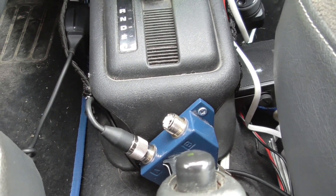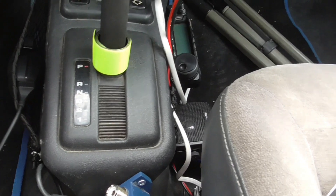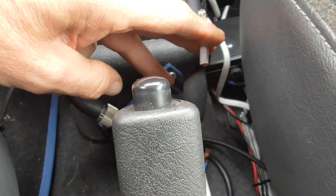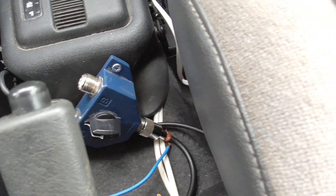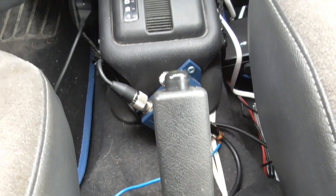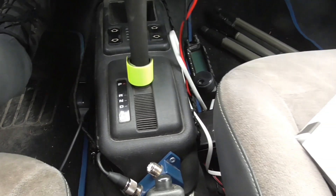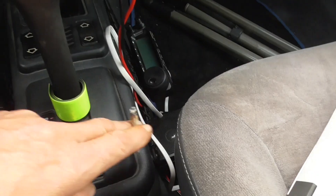Now, the feedback thing — I remember what I did in the Jaguar. I'm on a mag mount here, on a separate battery, and as you can probably hear, there's the noise of the engine, and also the charger charging up the second battery. Everything is independent of the car, but I have earthed the coax that goes to the radio, and I've earthed it to the car seat. What a difference. I did a little radio check just now with a fella in France down the road, and he said the audio was perfect. It was just irritating hearing my own voice coming through in a muffled form on the extension speaker.